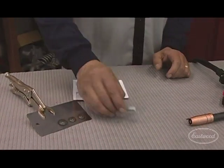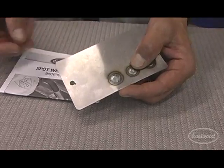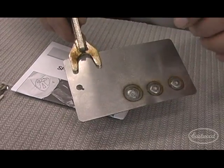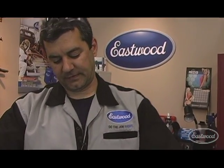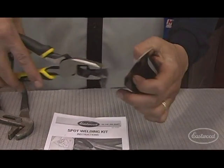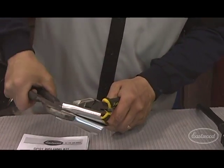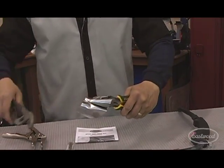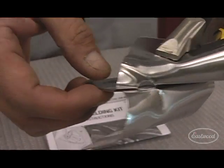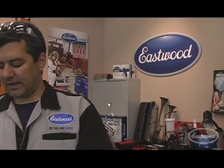We also include some double-ended 3/16 drill bits for doing plug welds. If you've got a small welder or you're working with really heavy gauge material, take the top panel, drill your plug weld hole through that, clamp them, and using the tip do the same spot weld through there — it assures penetration through both panels. These pieces here are still warm — something we just did — but to show you strength, we're going to have to literally tear the metal around those welds. That's the only way these welds are coming apart. So you can be assured you're getting complete penetration and the OE appearance you're going after. Click the link below and order your kit today.